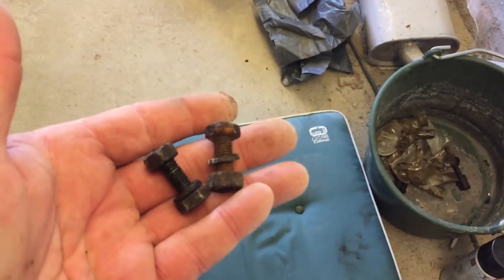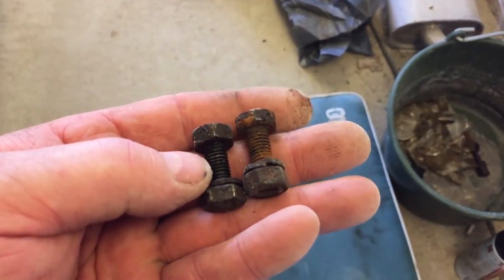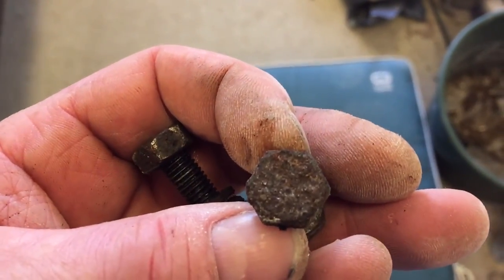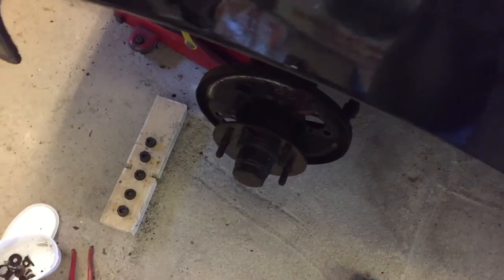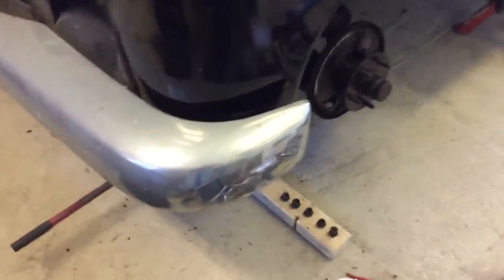Okay, I got the two nuts and bolts out, holding the brake cylinder in place. That was a really awkward job, because these ones here, which are on this side, were nearly impossible to hold still. But I got it moving eventually, and after getting it out, I now realize that I have to put the wheel back on, take the car stands back out, and lower the car in order to do the next bit, which is tackle the brake cylinder from the top.